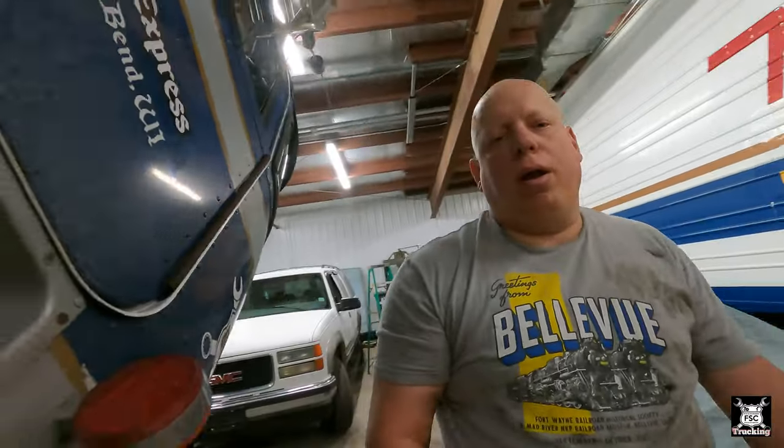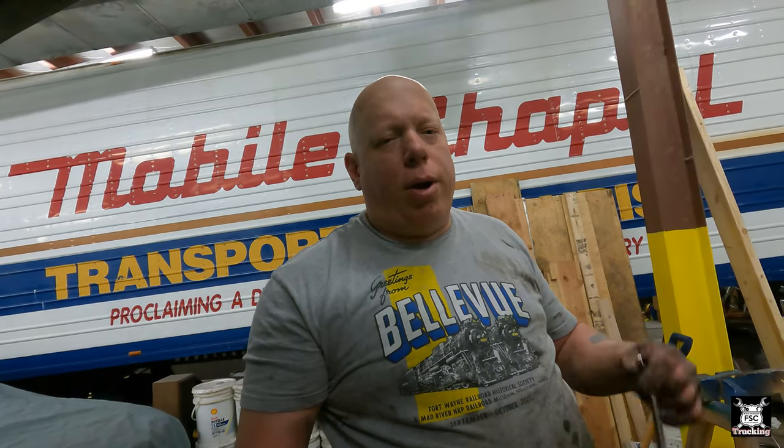Alrighty, boys and girls, now that I have the whole thing apart, I have to find top dead center of either the compression stroke or between exhaust and intake stroke to know which valves to do next. So what you do is you bar over the engine. I'm getting ready to show you where you pin the flywheel, because what you're looking for is valve overlap. I'm almost there.